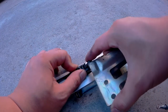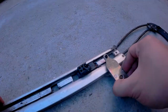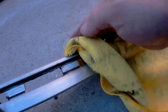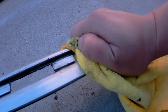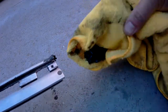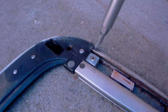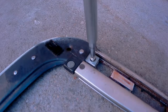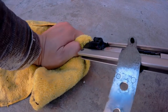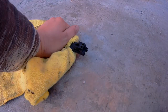Now I know this side isn't broken yet, but I'll just go ahead and break it so it can be repaired. Next you want to slide this bracket over like so, so this piece can be pulled out through the front. This next part is going to require some muscle — grip it tight, wiggle it back and forth, and try to get it out. Now remember how this side wasn't broken yet? I'm pretty glad I pulled it out — taking a closer look, you'll see that there are cracks all along here. Moving on to the other side, go ahead and remove this Phillips screw, separate these two pieces, move this bracket over, then grip this cable really tight. Instead of muscling it out, all you need to do is yank it and there it goes — it's out.